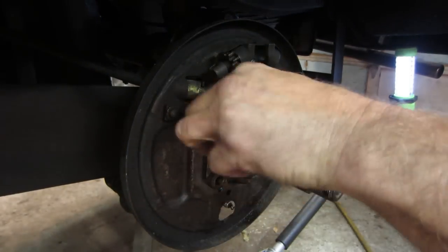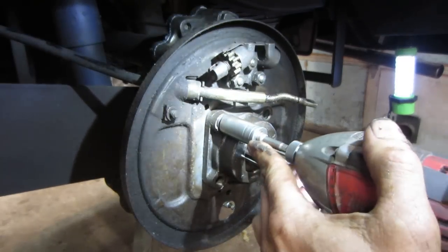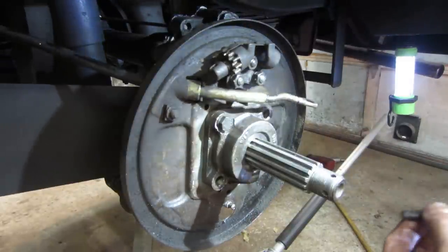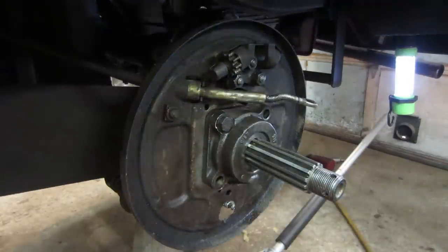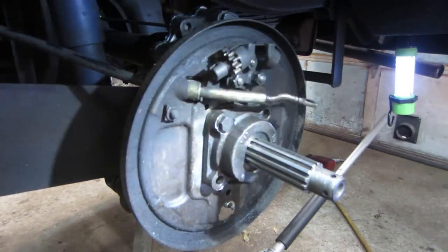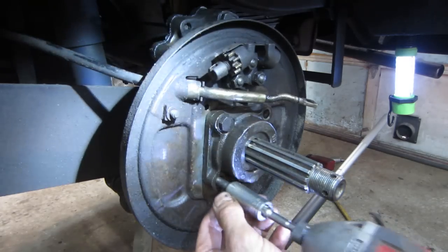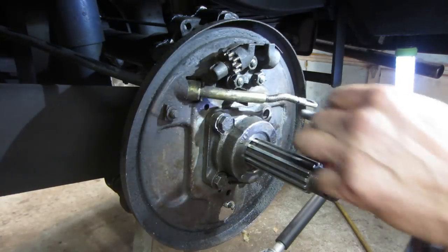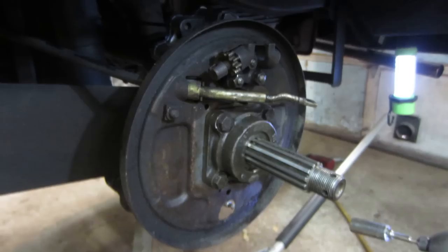And let's see if we can get those guys to start, and we're gonna run them in kind of sort of, but we're not gonna crank them down again just like we did with the other one. We're gonna let that sealant set a little bit. I also want to come back with an air gun and blow through that hole in the back side to make sure that that passage didn't just get clogged up with that sealer. And we'll let that sit.